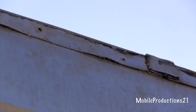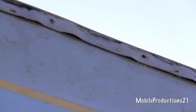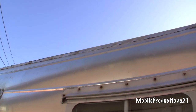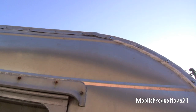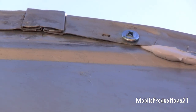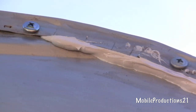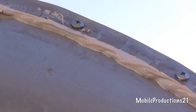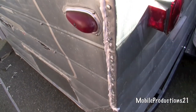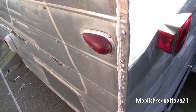You can see when you pick it off there's no sealant actually inside that seam. Since they didn't have silicone back then, what I've been doing is siliconing the seam — applying silicone inside the seam instead of externally only. This is a marine-grade sealant, an adhesive sealant. It's about twenty-some dollars a tube.